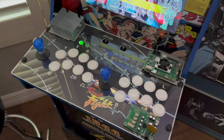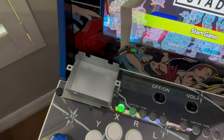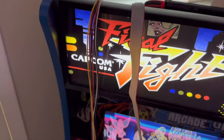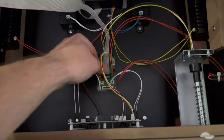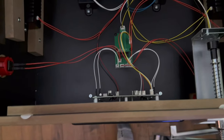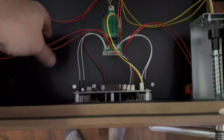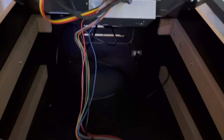On the face of it, it doesn't look like there are that many bits. This was taken out of the 1-up, this is the new PCB, there's a metal case which goes in the middle, and there's a couple of cables. This big ribbon cable here is essentially from the control deck, so all of these wires have to go back into the original buttons on the front of the 1-up pin. And then we've got to take out what was the video card, or whatever goes in there, and replace it with the PCB.